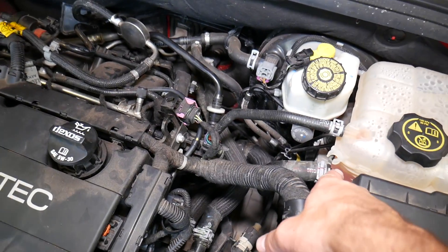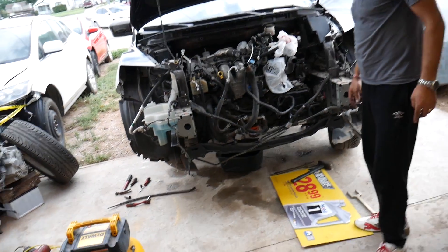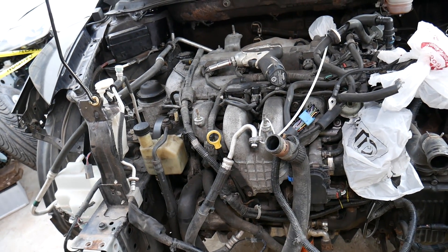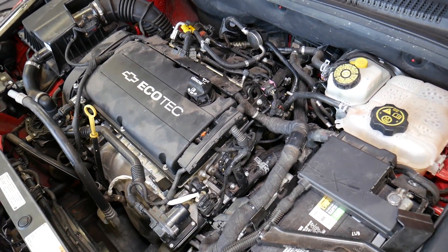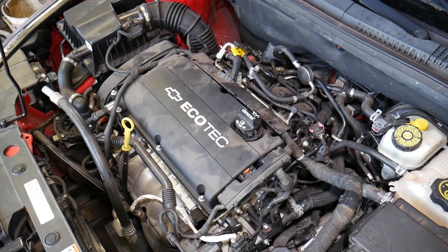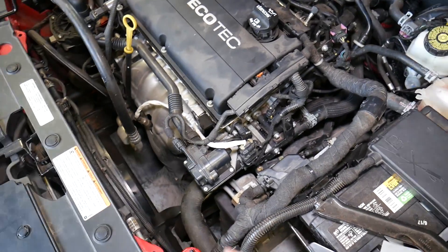As a result you will see bubbles in your radiator overflow tank right here. This is what's happening here — this car needs a head gasket, that's what we'll be doing. Same symptoms like what we have there on this Chevy Cruze. We've had many Cruzes in the past with overheated engines, especially the 1.4 — many of them had problems. If you notice bubbles in your tank and you bled the cooling system the correct way, most likely you have a bad head gasket.